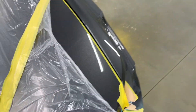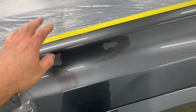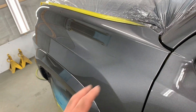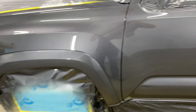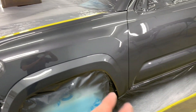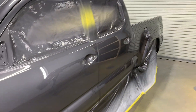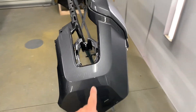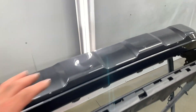This color flops a lot, but since there's no color on top of the fender it should match the hood just fine. My color blends into the hood color right in this area so it's on a roll, which helps transition the color. I spent a few hours trying to dial in the color to match as close as I could get it. Looks like it turned out really good — nice gloss to it, everything laid out nice, didn't get much trash in it except that little bug. Bumper turned out good; it had a little damage right there but the tag will cover that up.